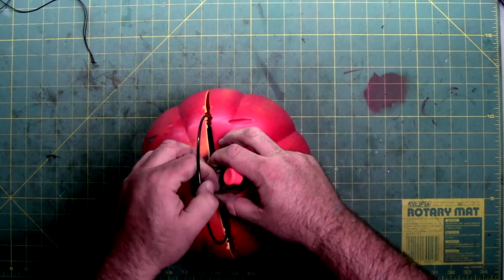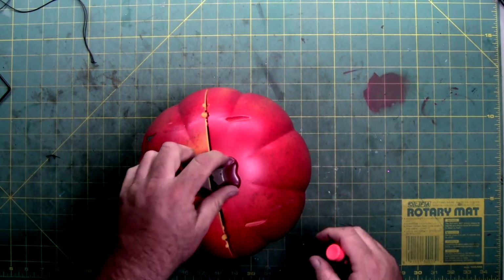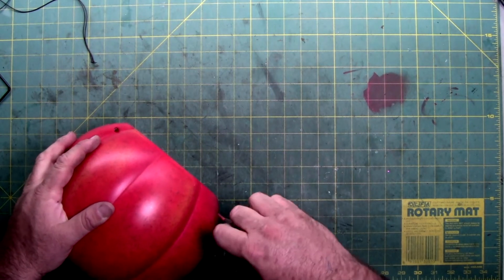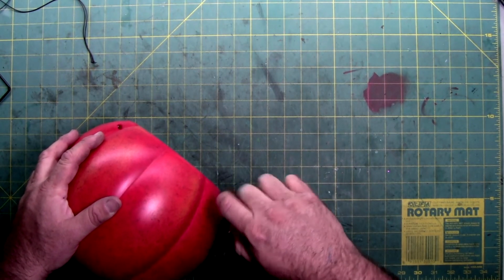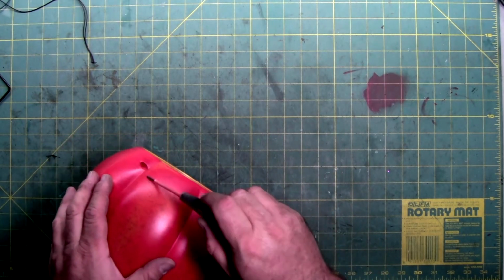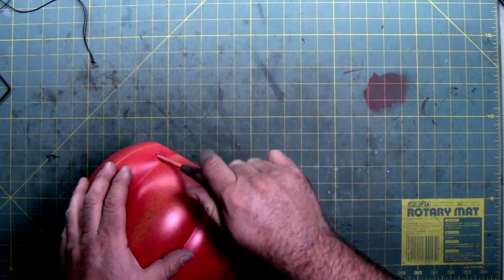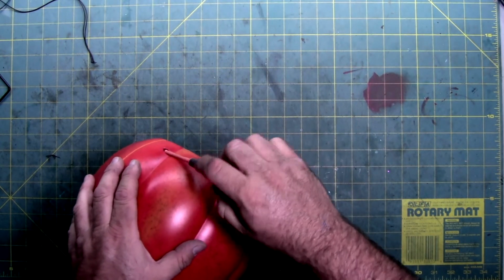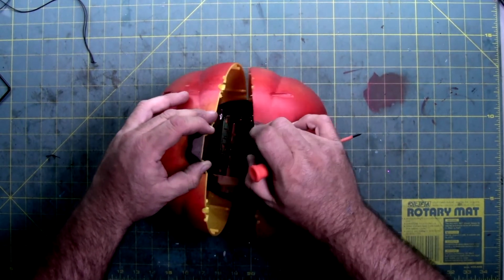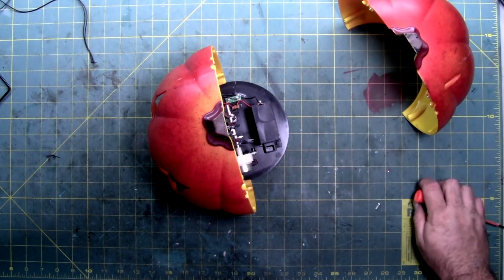Ooh, that was a loud pop. That would be the spring-loaded handle coming out. There's 4 screws. They're number 2 Phillips. They're deep in there, so you need a long, thin shank screwdriver. My standard number 2 that I normally use, the shank is too fat and I can't get it all the way to the bottom where the screw heads are. There we go. So there's the back.